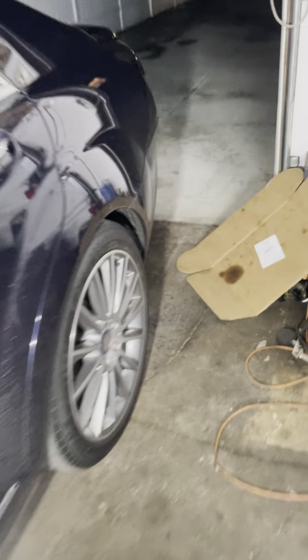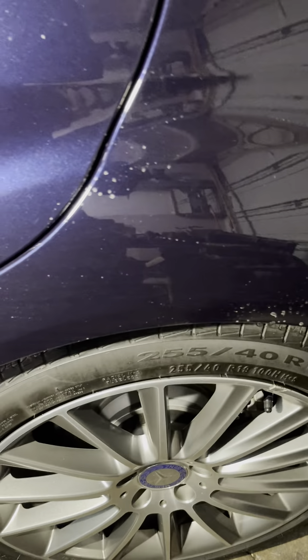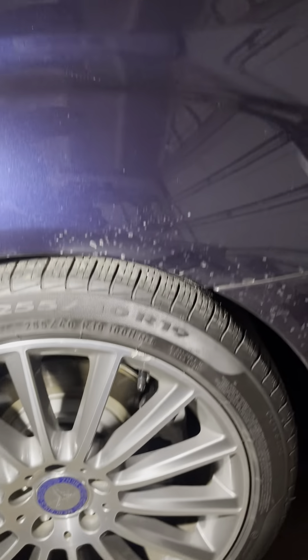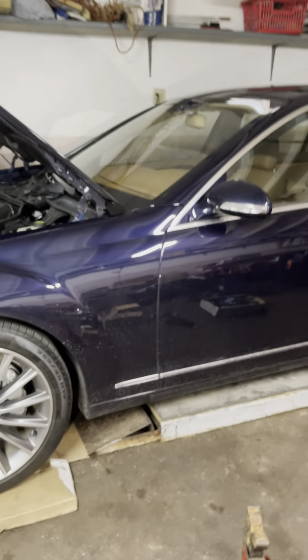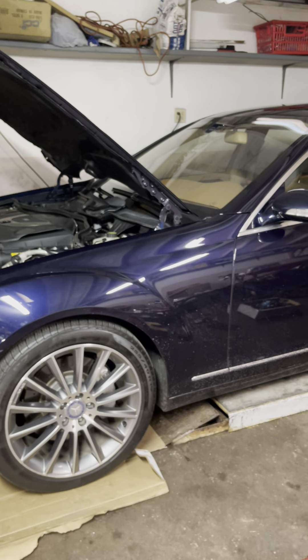In the rear there's only one sensor - the leveling sensor in the rear you just bend the bracket a little bit to lower the rear. So I have the car sitting about half an inch lower than stock ride height, plus I have it on sport mode which lowers it another half an inch automatically.